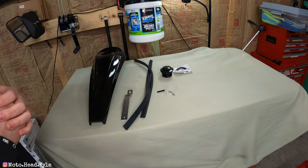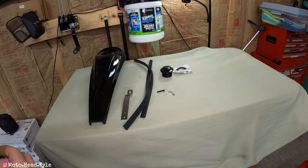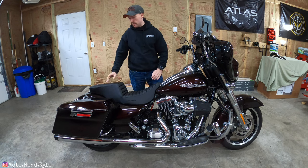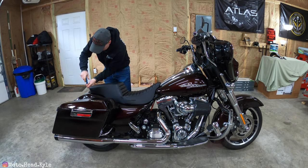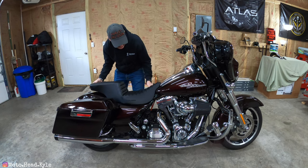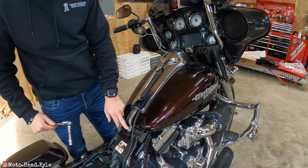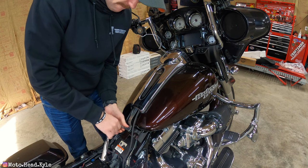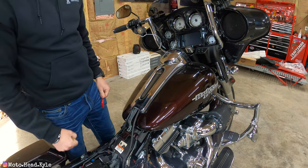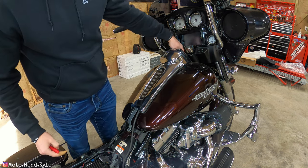Let's hop back to the bike. I'll show you the steps needed to get the stock cover off, then we'll come back and put the grommet on and get the bracket ready to mount on our Street Glide. The first thing we need to do is remove the seat — if you still run the stock setup it's going to be a Phillips. With the seat removed, you're going to take out the bolt right down here in the center, which is going to be a 3/8. With that bolt out of the way, I'm going to use a 5/32 T-handle, and there's going to be an allen bolt right in the front of the console.